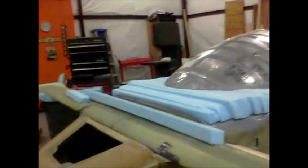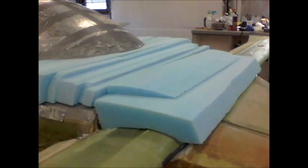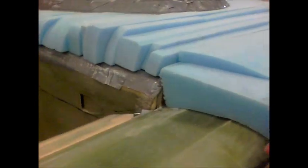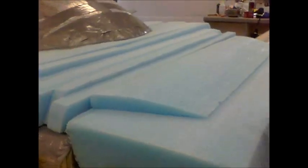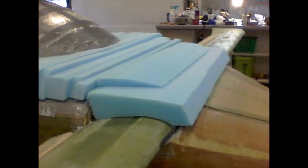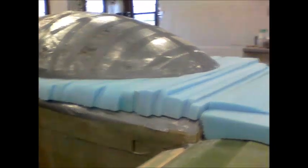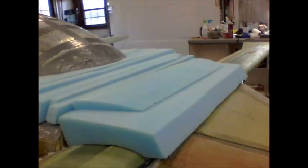Let's get to work on the canard fairing, which is this part right here. To start, I used my hot wire and made some templates, and cut out the top contour of the canard onto the bottom of the fairing and set it on there. There's another little piece right here, and I'm about to flox that down onto the canard. Once that dries, we'll start sanding and fairing this thing out to make it look nice.